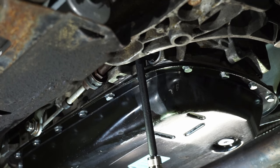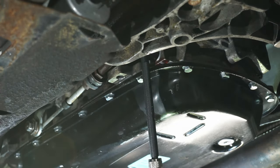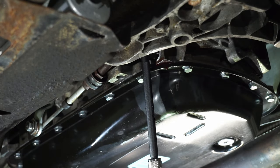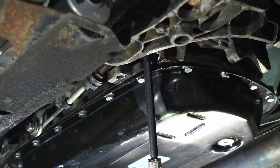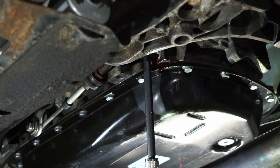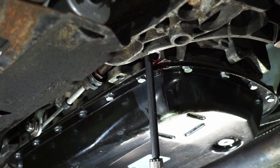So we just turned it off because my bottle ran out of fluid. I'm gonna refill it, and we're gonna continue to pump until fluid comes out. Looks like we're pretty close though. All right, we're slowly starting to get a drip. Let's just make sure they work good. Yep. So we're going to close the valve. That means we have sufficient fluid for the first phase of filling.